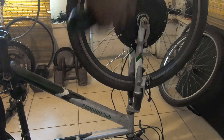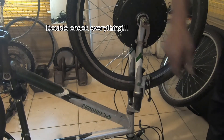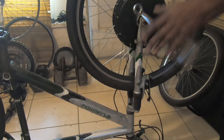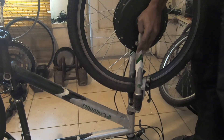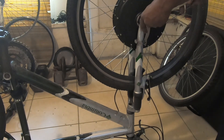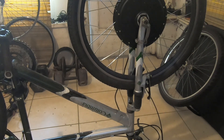Got my tire pumped up. The next video we'll be doing the wiring. Got your tire installed — double check everything and make sure everything is tightened down real good. Don't be scared. Take the time and make sure you got everything right. And torque these down — that's another thing, I didn't even torque these down. Take your 21 millimeter and torque these nuts down real good. There you go — it ain't going nowhere. Next video we're doing the wiring. EV Bike Rides, we out.